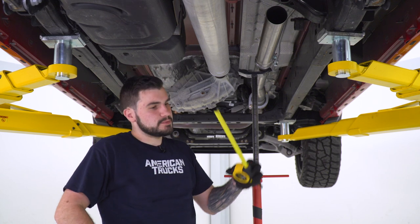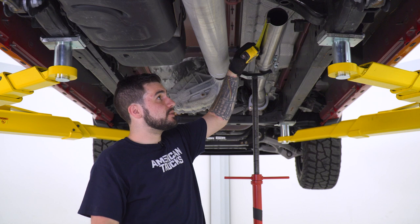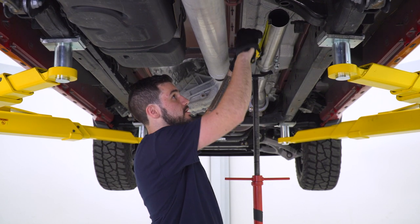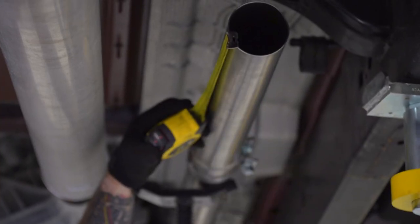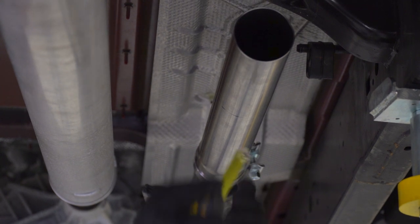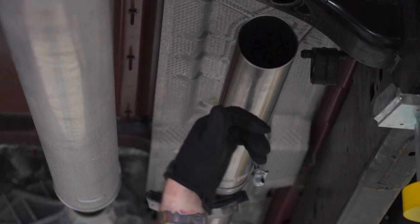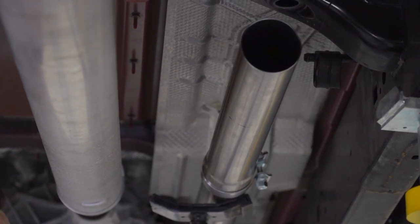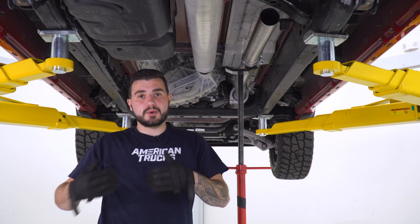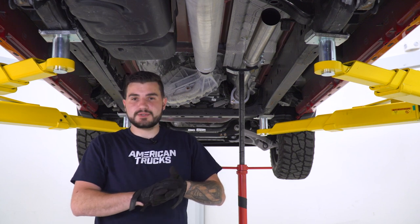And what I'm gonna do here is basically take a tape measure, put it up against the end there, and I'm just gonna mark at the 9-inch mark coming back here, so I know that's where I'm cutting. Perfect. Again, measure twice, cut once. You wanna make sure that that is completely correct. Going both ways, that's 9 inches exactly from the end there. So we're just gonna cut off that little bit, and it'll fit perfectly on our wheelbase. Now at this point you wanna make your cut, whether it be a sawzall or a table saw like we're gonna use, just make sure you're being safe, use eye protection and gloves, and then of course, let's do that next.